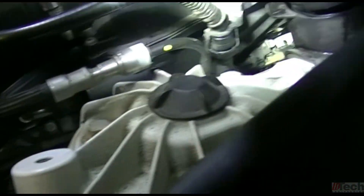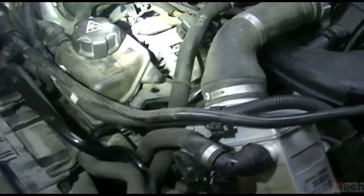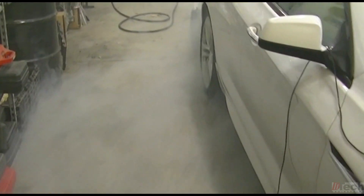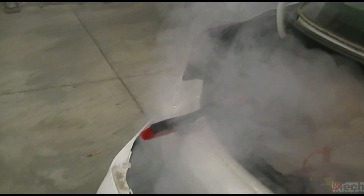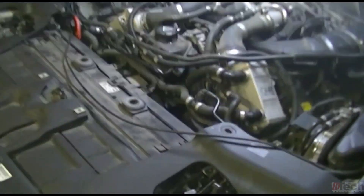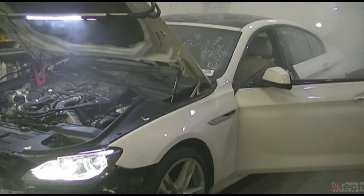We did get two new injectors in there for any fuel leaks. Making sure everything is good. We've got a smoke show going on — with how far the timing was off there's a lot of crap burning out of the exhaust, especially on that bank. But there it is — it's up and running. It's alive.